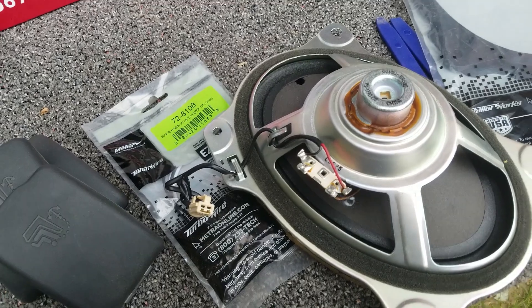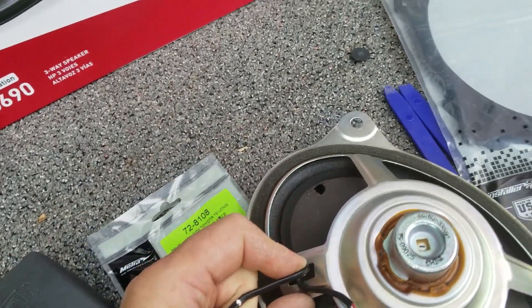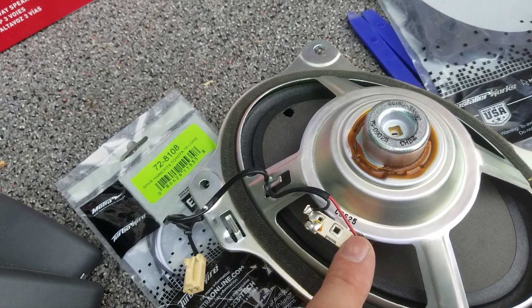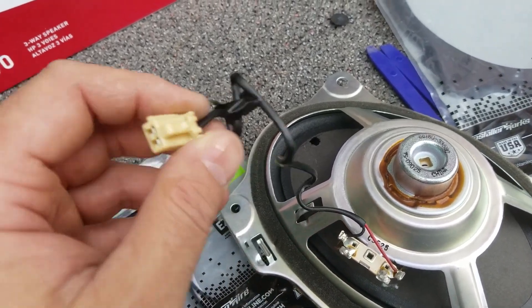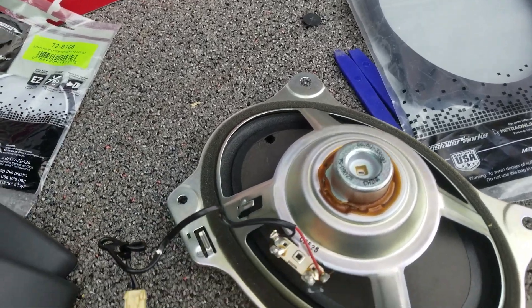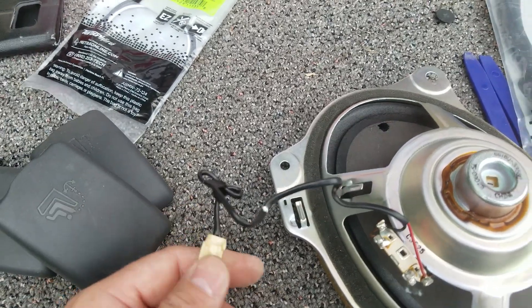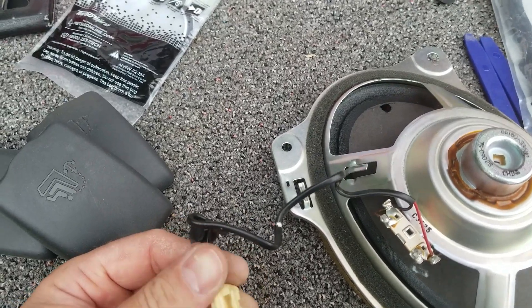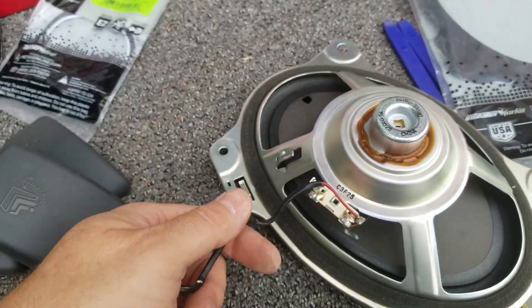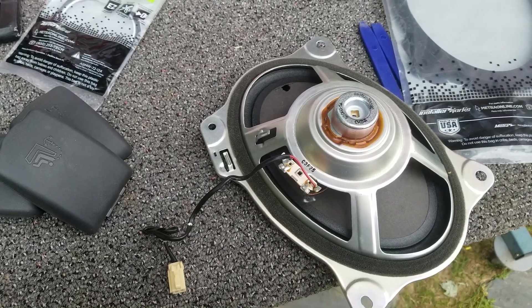If you wanted to, you could take this plug from the stock speaker, pop it off, cut it or unsolder it, and solder it onto your new speaker. Or get the proper connectors for your new speaker, solder them onto the end of this, and make your own adapter. You could also just solder some wires on to give yourself a bit of a tail, and cut the plug off in the car and solder it there as well — with shrink wrap over the joints or some electrical tape. Don't use the crimp-on ones — they don't work. You'll have your speakers turning on and off every time you go over a bump. They corrode, the wire breaks — they're garbage.